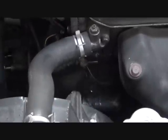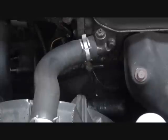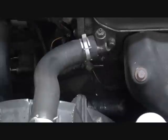So as you're drawing the transaxle to the engine, make sure that you rotate the crankshaft, and you do that at the front pulley. Make sure you turn it in a clockwise direction as you're viewing the pulley. Make sure that there's no binding, that the splines are lining up and that it's sliding together smoothly. You want to keep checking that throughout the process. The trick is the alignment, getting everything level and aligned so it goes straight in.